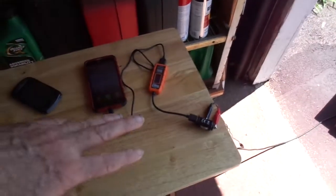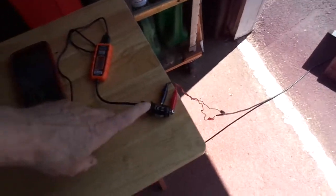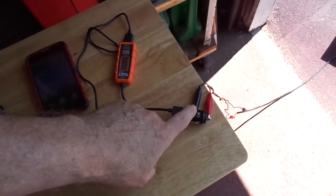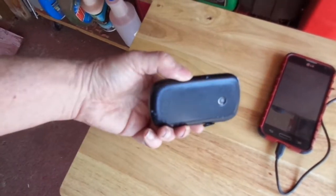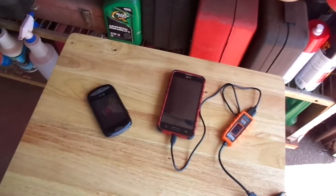The nice thing is you don't need a charge controller. You're counting on the little regulator in here to take 12 to 14 volts and knock it down to 5 volts. It's as reliable as a plug like that can be, but it always has the possibility of going bad — even in a car it could burn your phone out if it doesn't work right. What I did in my first few experiments was use an old obsolete phone that can only hold a charge for about a day, just to test it out and make sure it worked before using it on my regular phone.